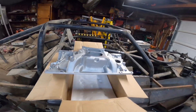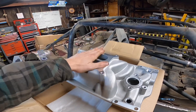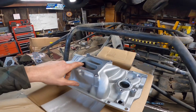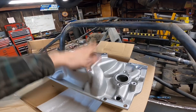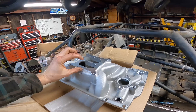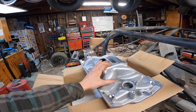This is a square bore carburetor adapter, and the Speedmaster one was a spread bore, so I'm a much bigger fan of this. I was looking at Summit's website and they have another intake manifold that shares all but one part number — instead of 062 it's 060. The only difference I can tell is that one has a notch right here that basically equals out the air, so if you bolt your carburetor right to it it'll work a little better. These dual planes seem to like a one-inch open spacer — they always respond pretty well to that. I wish I would have got that one, but I have enough hood clearance for a one-inch spacer so I'm not really worried about it. That would probably be the better option and it's the same exact price.